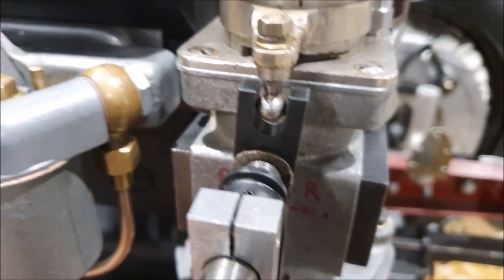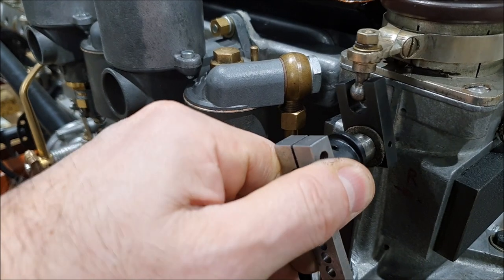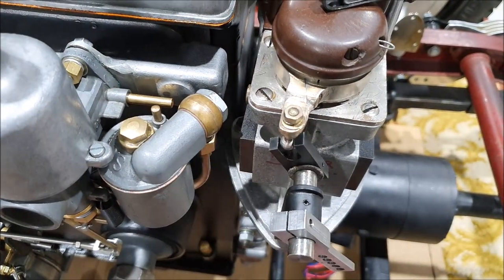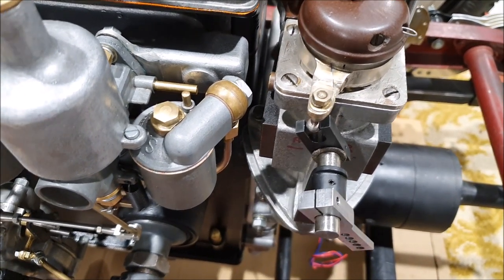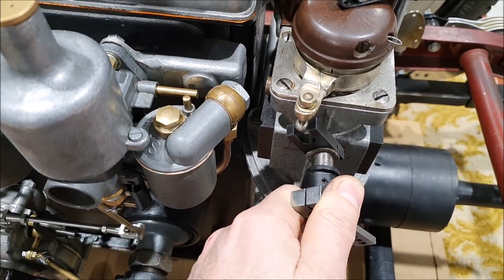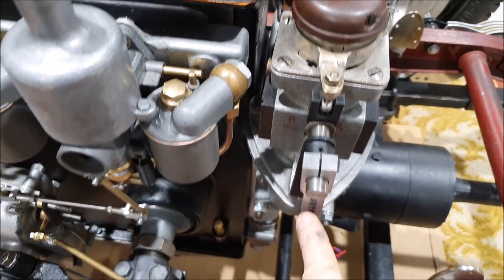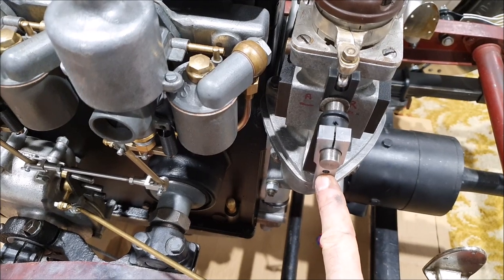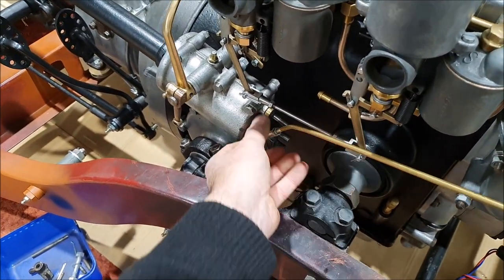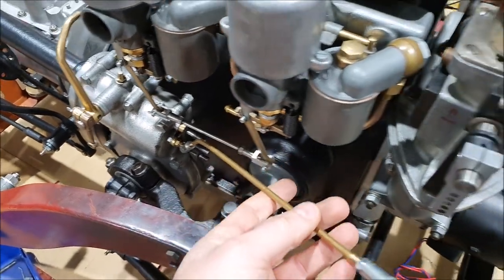I've actually drawn a little white mark — that's effectively about 30 degrees. So it gives me an idea of how much movement there is on this thing, since I've never seen one before and don't actually know how much motion you need. All I need to do is set this up so that the linkages are on the right hole, up fairly close, so that when this is at the ends of its travel — because this effectively works as a stop — it can't go any further than these two points, and I make that my maximum and minimum. That should give me the full range of travel on the advance-retard lever in the car.